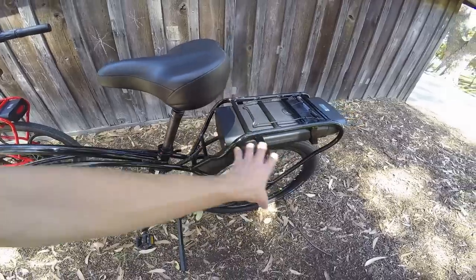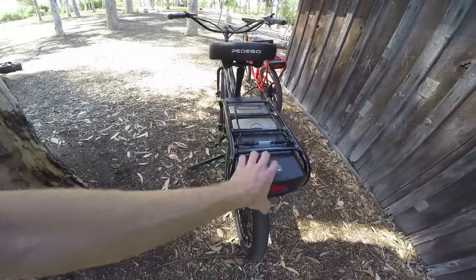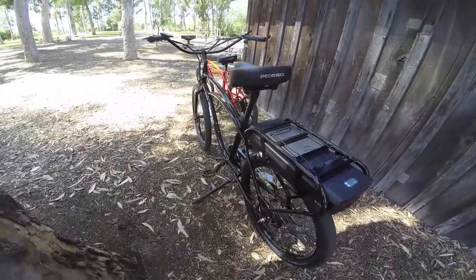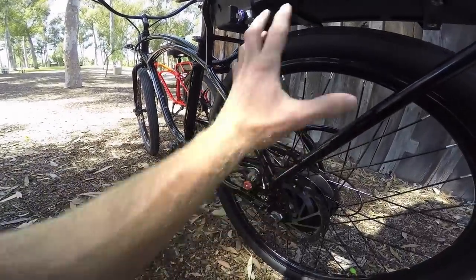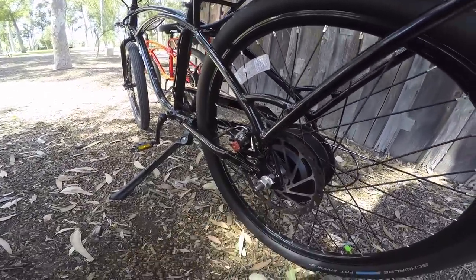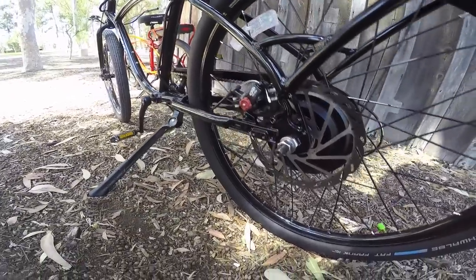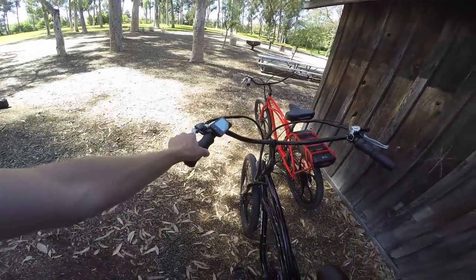There's extra tubing around the battery for protection — it's a plastic casing, so it's nice to have metal surrounding it for extra strength. It's attached at the seat stays. Down below there's a nice big disc brake — mechanical Avid disc brakes with 180-millimeter rotors, backed up by those Tektro levers, pretty easy to actuate and tune up if needed.